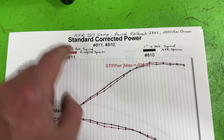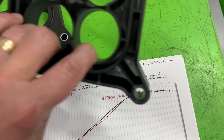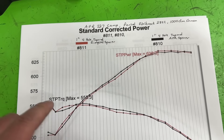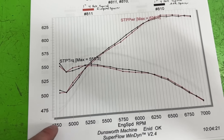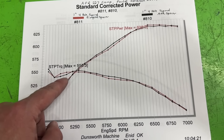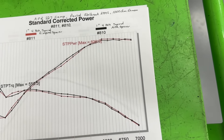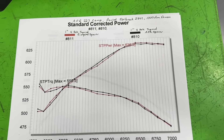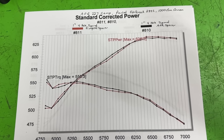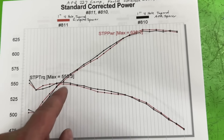What you see here is this red line — which is really hard to see — this is the dimpled four-hole tapered spacer. The black line is the AFR four-hole tapered, which has been the best of the 4150s before. Tracking through the graph, the red one looks a little bit better at the very bottom around 4700 RPM, worse in the middle, then a little bit better at the top, then about the same. The differences are pretty small.